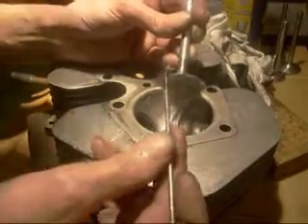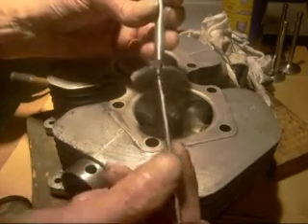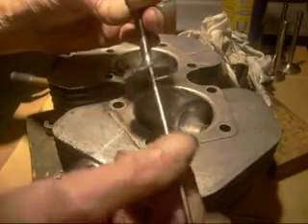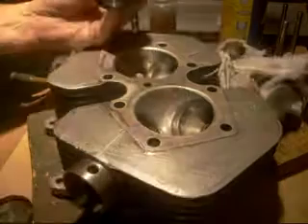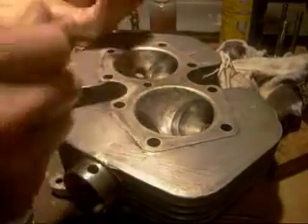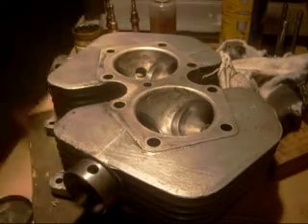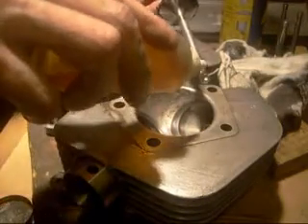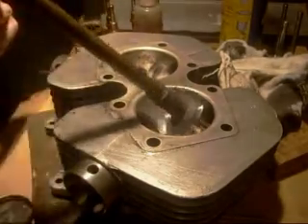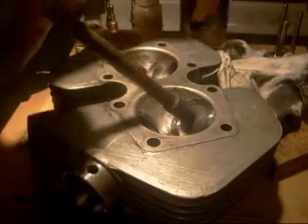I'm working on the fine grinding paste now. It won't take as long as the coarse because there's hardly any cutting — I'm just dressing them with this now. Make sure you've got all of the coarse grinding paste out before you go onto the fine. I usually put the oil in the collet groove and then it takes it down into the guide where you want it. If you just put it on the shaft, it'll scrape it off as you push it in. I'm going to be a bit more careful and do it more in thirds because I want this smooth enough.